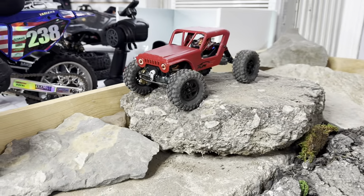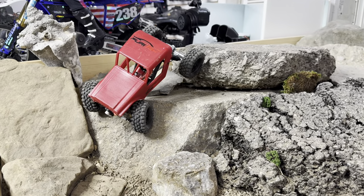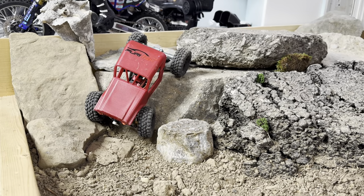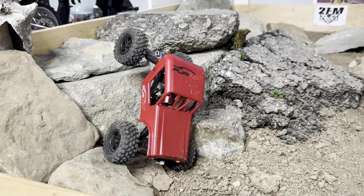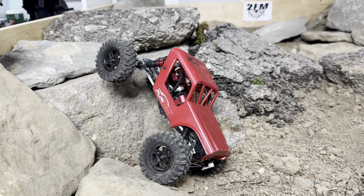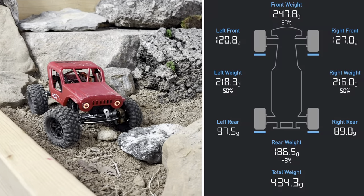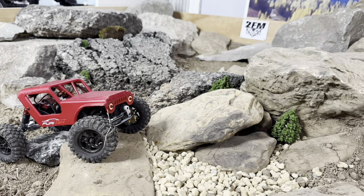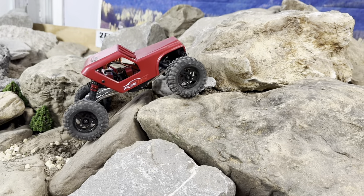You can see right away I had to put the lights on beast mode — I love the lights on this truck and found myself enjoying the body more than I really expected to. When I first seen it I thought, what is that? But getting it in hand, I do like it more. I love the front end part of it. My main issue is just kind of the rear. Coming down this, you can see it gets pretty steep when your driver front drops in that hole — having the suspension tweaked a little bit would keep that rear more planted. It's just kind of raising as the front drops. The truck is balanced out well — I put it on the scale and it was very close to 60-40, 50-50 on each side. It does have the brass outer portal covers on the rear. It just needs a little work on the shocks.